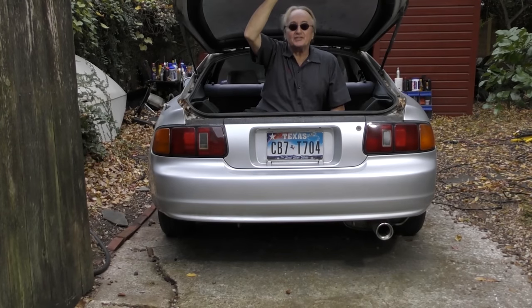Bonus question: what do you think of a 2003 Lexus LS430 with 136,000 miles for $3,000, pulling a homemade trailer of 1,500 pounds, a thousand miles a week? That baby has an interference engine — at that age and mileage you'd have to put a timing belt on, and most mechanics are going to charge close to a thousand bucks for that. Realize luxury cars aren't really made for towing stuff. A thousand miles a week, you're looking for a different kind of vehicle. It's a V8 Lexus — they make great cars, but as they age they're the most expensive of all the Toyota products to repair. The brake master cylinder alone: the part was eighteen hundred dollars and I couldn't get it at AutoZone or anywhere because they didn't sell them — it was a unit with all kinds of computer stuff on it. I would look for a different vehicle if you want to pull a trailer a thousand miles a week.